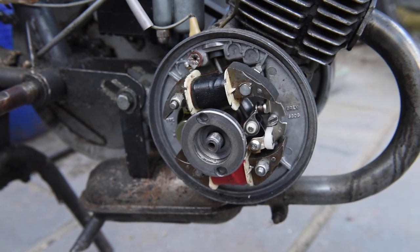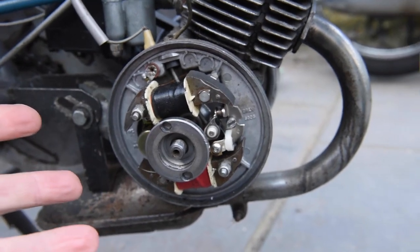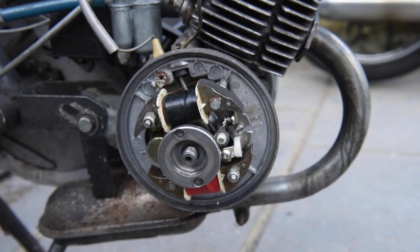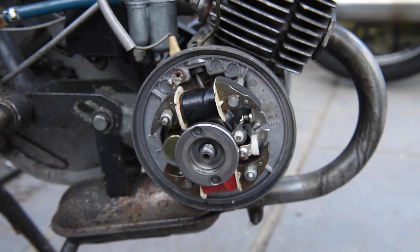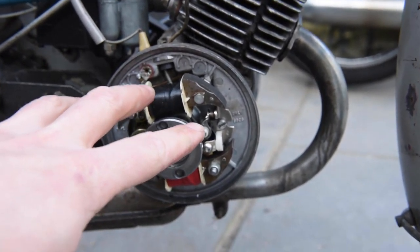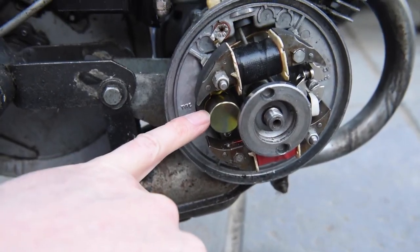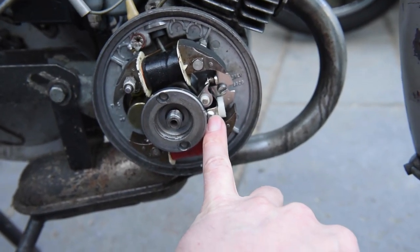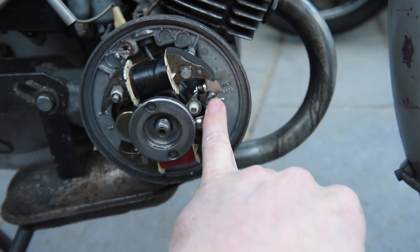It wasn't as straightforward as I imagined, because I didn't have any sort of reference, and I find it really hard online to find any information as far as wiring diagrams go. So I asked a few people on a Facebook moped group and finally got there. All three wires, condenser and all, go to the single block on the points, and then you adjust the points.